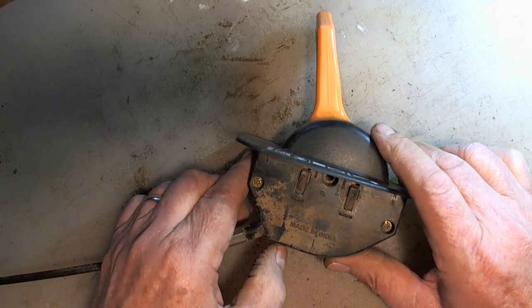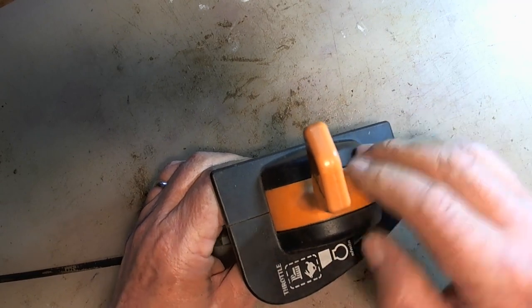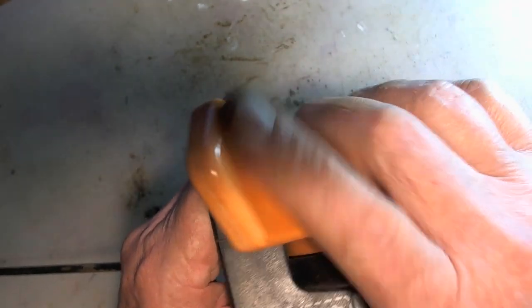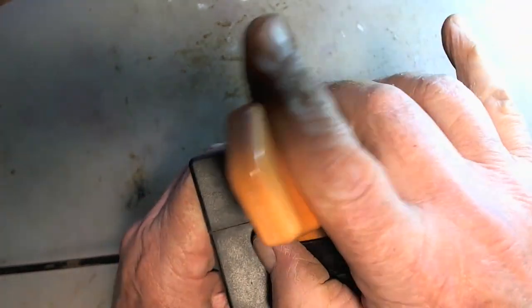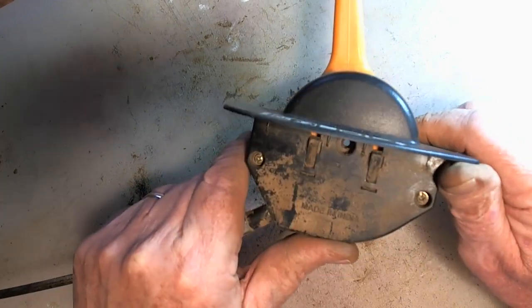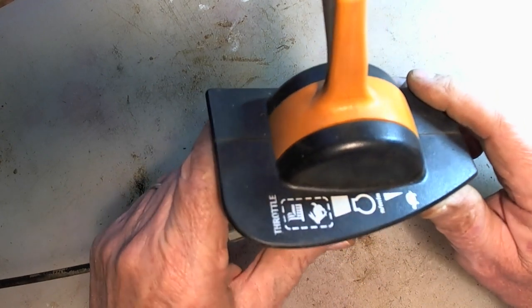Well, let me mess with it a little more here. I got it back together with that little roller pin in place - sorry I didn't show you but it was kind of a hassle - and it does click, hopefully you can hear it. So now I'm at throttle speed and I'm going to go into the choke, so back down. You hear that click? That's supposed to be top throttle and then all this is now much tighter. So having said that, I probably could use this unit again, but the fact that it's missing one of the springs and roller pins means probably best to replace it. So I think I will do that and we'll put a new one in.